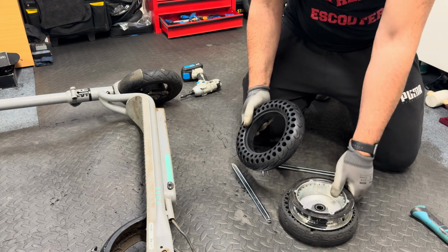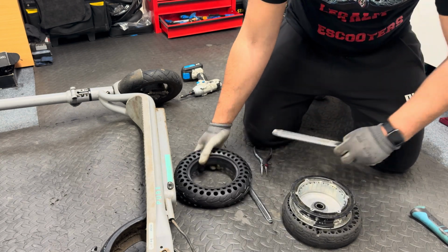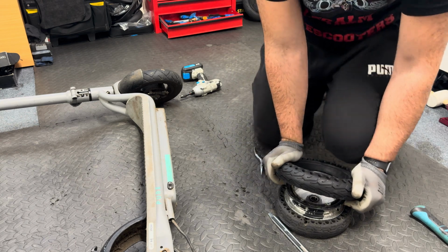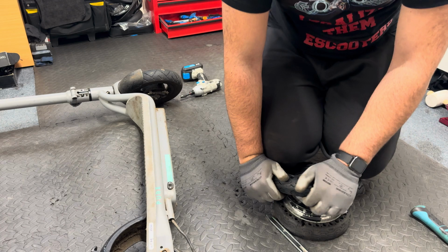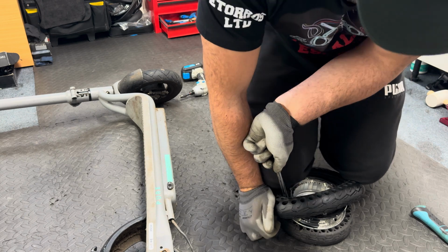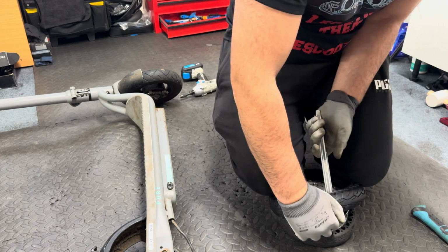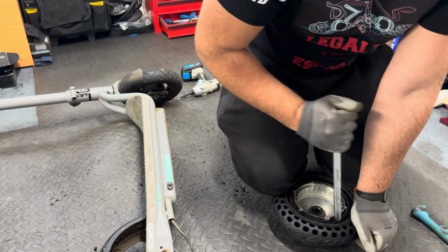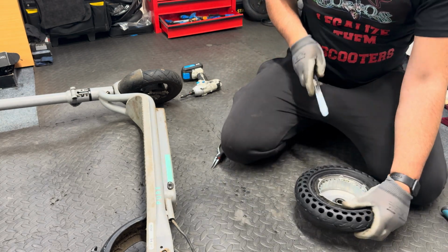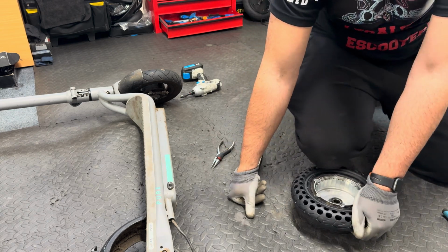Okay, the direction of the tire that needs to come is to my right. You see the rim standing like this. I have the direction this way. Yeah, and when I'm going to fit the tire, I'll start one way like this. I'll keep it with my knees down, and I'll start with only one lever. One, then I'll move my knee in front. Two, and then three. So basically this is the first step that you need to do when you fit a puncture-proof tire. Then the second one is to align it on the rim and put it inside.